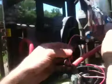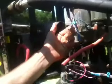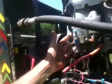The Kohler engine — the wire with the two diodes on it is the energizing wire for the fuel solenoid on the carburetor. So the one with the diodes is for energizing the fuel solenoid? Yeah. Okay. So that one you want to have key-on power to that. When you turn the key on, you want power to that.